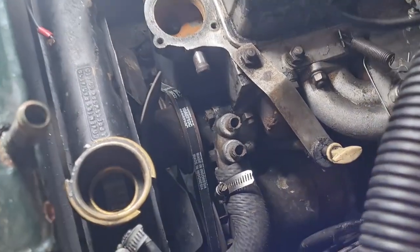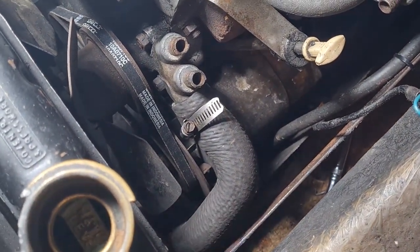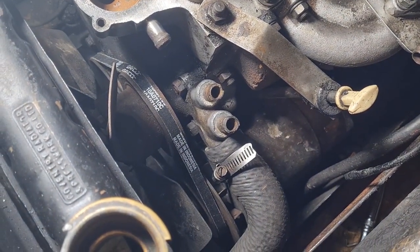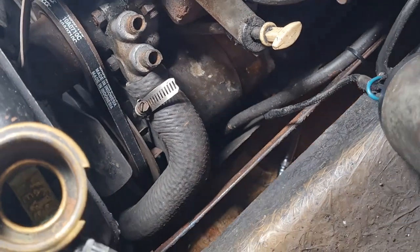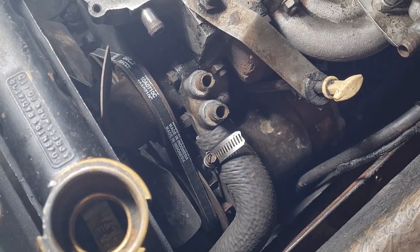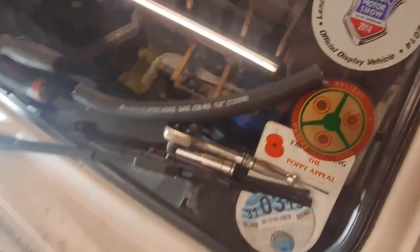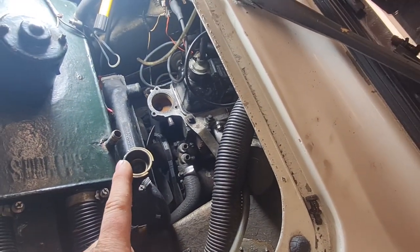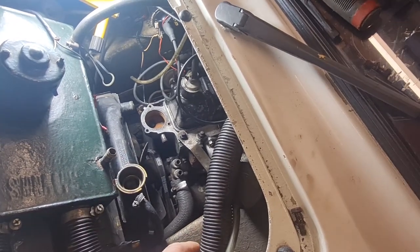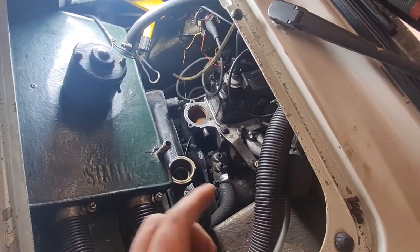I've been doing a little bit of research and found out this actually had the wrong size belt on it, which is why that pulley was so close to the hose. I've changed the belt for a new one which is 710mm rather than the 725mm that was on there. That's tensioned up and there's plenty of gap between the pulley and the hose now - I'm much happier with that because if anything had moved it would have rubbed through the hose. I've also got some heater hose already cut to length - two small pieces and a longer piece for the rad to connect up to the inlet manifold. I want to get those on with new clamps, get the thermostat housing on with the new thermostat, get that all sealed on, then put water and antifreeze back in and see how it runs.